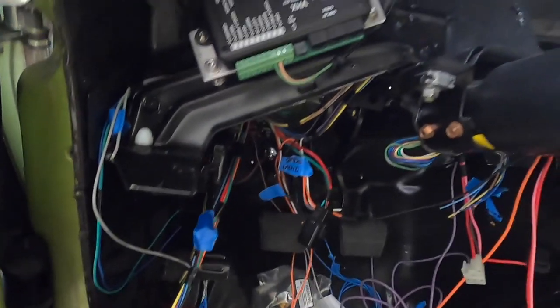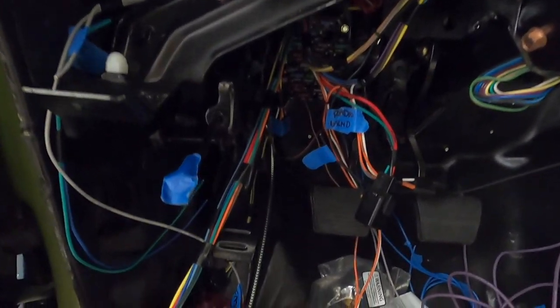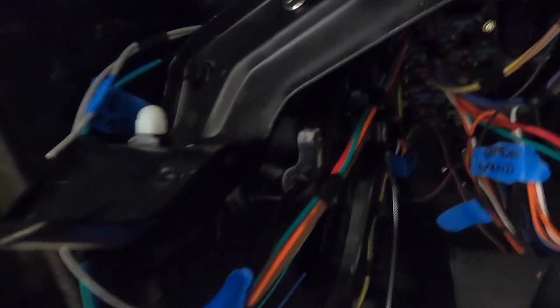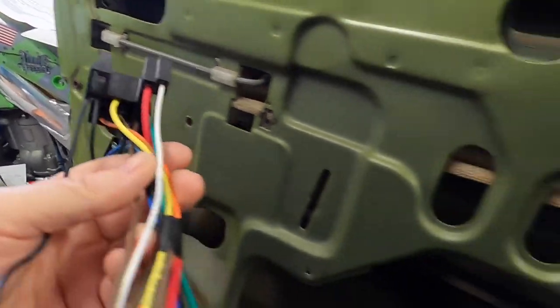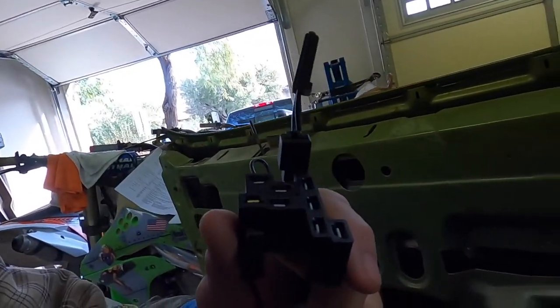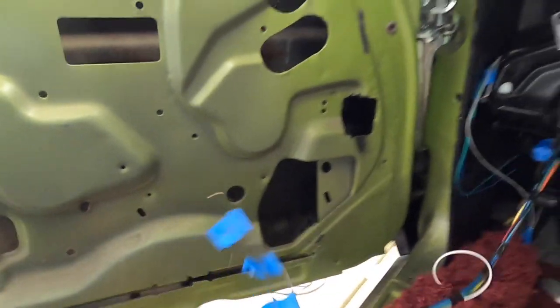Lauren and Pete, North Las Vegas. We're back on a Camaro. Still working on the wiring — I was trying to get my dash done. This is the headlight switch harness that runs about another foot back to the fuse block, and this is how much harness they gave me. It runs almost to the end of the door — so all the way from the fuse block to the end of this connector it's like five and a half feet. I only need about two, so there's too much here to coil up and hide behind the dash, and I'm going to have to shorten the harness.